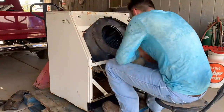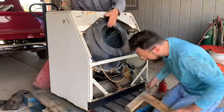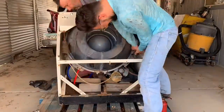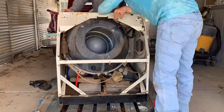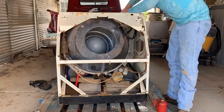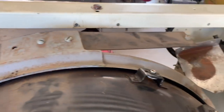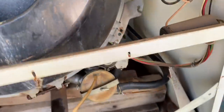What I'm doing now is taking apart the front half of the barrel. This barrel is not one big piece — there's two halves and they're sandwiched together with a giant hose clamp. You can kind of see it around the outer ring of the washing machine. We got to take that hose clamp off and I'm going to take the front half out of the machine. Here you can see the bottom of the hose clamp clamped together with a big nut and bolt setup. It goes around the entire outer ring and there's a big gasket in the middle that I'm assuming is giving me that giant leak.